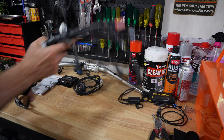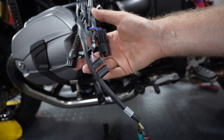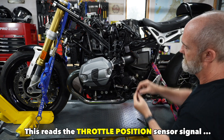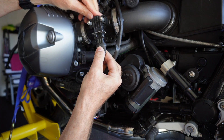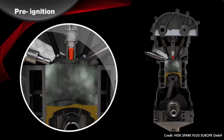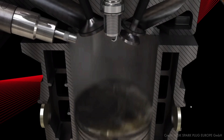Now you can see laid out before you all the sensor connectors and the Rapid Bike harness — but where do you plug in all these connectors? Starting with the TPS sensor: this reads the throttle position sensor signal, more precisely the throttle valve or plate position. It ensures the appropriate amount of fuel is injected into the engine combustion chamber based on the current throttle position. This information is also used in adjusting ignition timing to ensure the spark plug doesn't ignite the mixture too early — before the piston reaches TDC — nor too late.